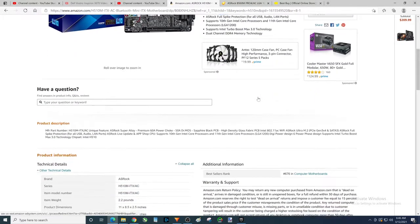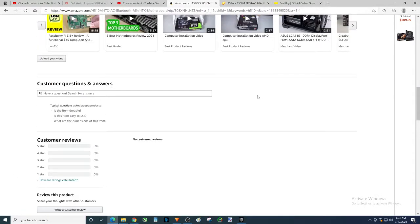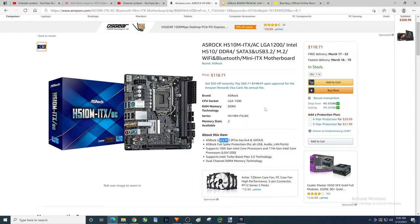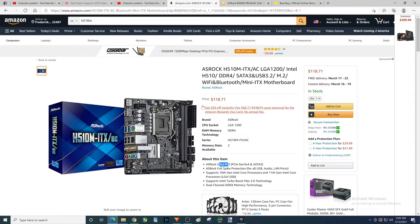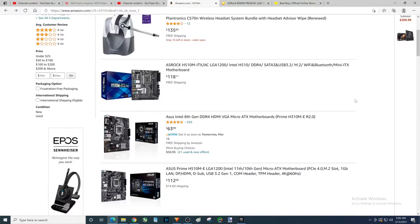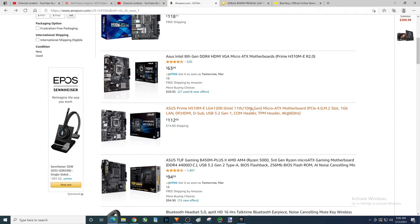Now, RAM speed wise, on some of these you will find 11th gen will allow you to run a wee bit faster RAM. But overall, in general, for 10th gen you're stuck at what the i5 was. i5 and below was 2666, i7 and above 2933. So H510 is not a great starting point, I'd say.